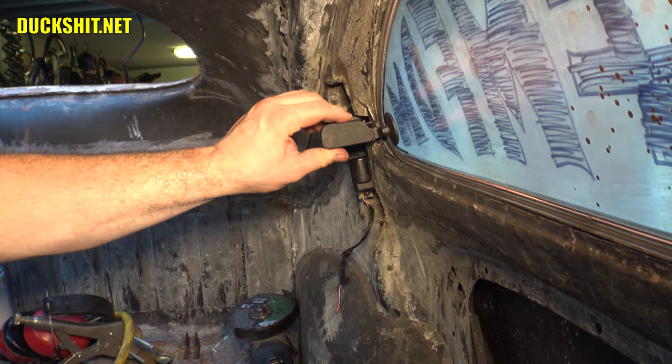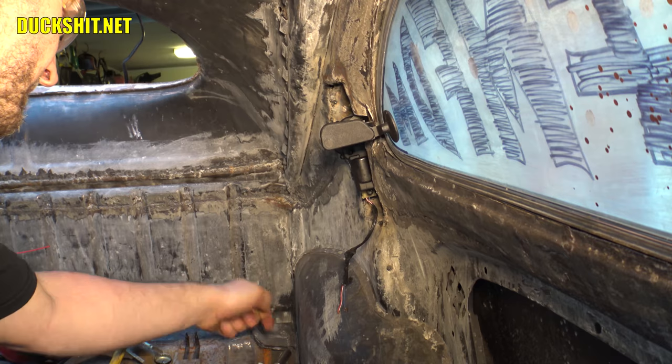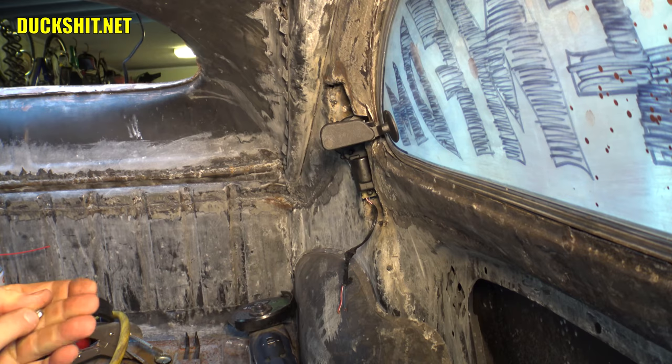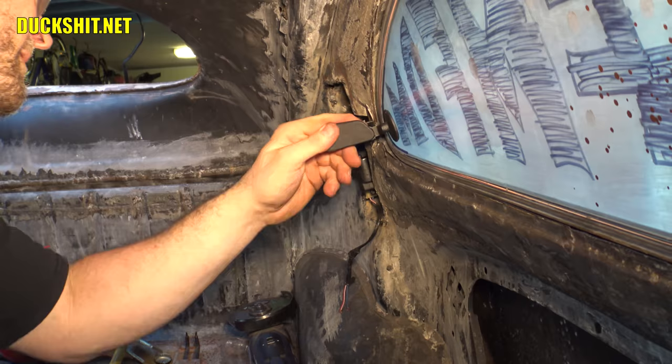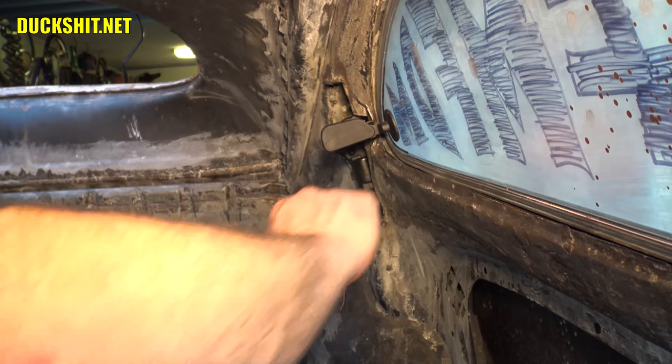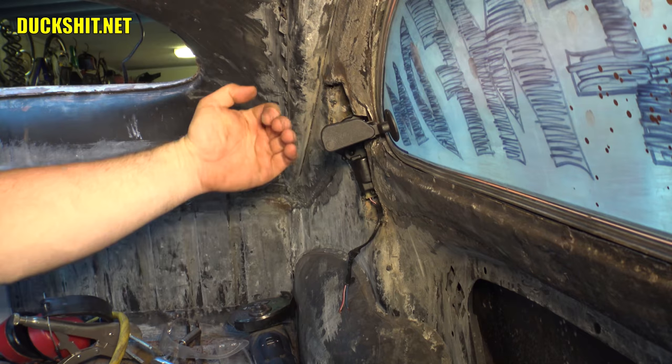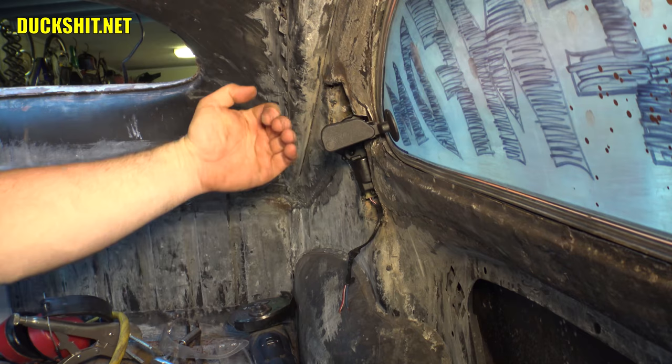From the outside, we're going to go ahead and drill our hole where our bolt is going to go through. Before I do any of that, just to make sure everything is straight, let's put our nuts back on. I look in here and it looks like I need to hit the inside of the box with a punch and a hammer and bend it just a little bit. It's almost where it needs to be, but looking closer, it needs to go in just a little bit more — it appears it's the box that's not allowing this to pivot as much as it needs to.